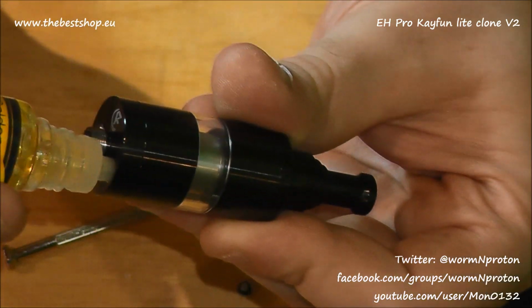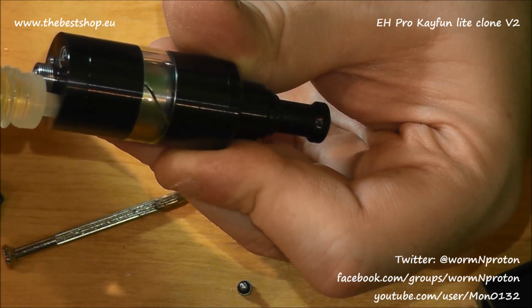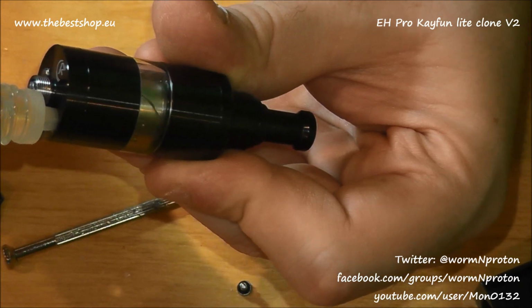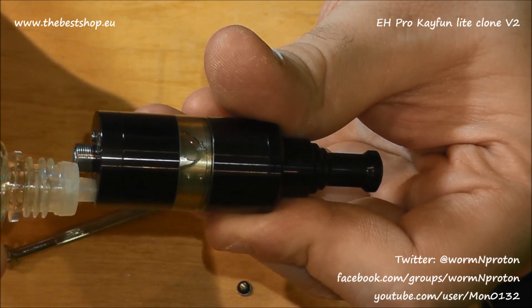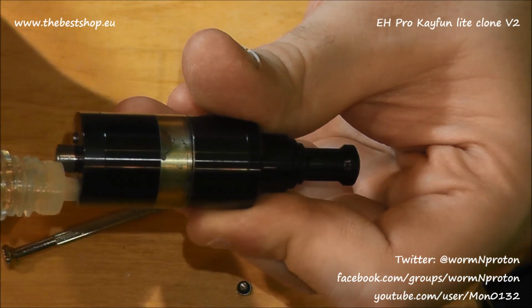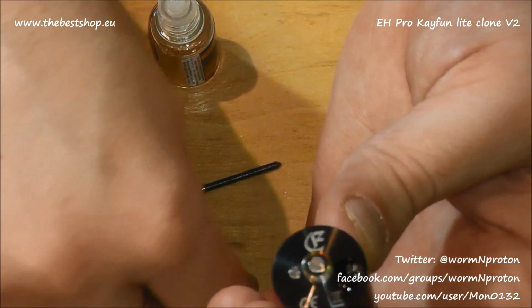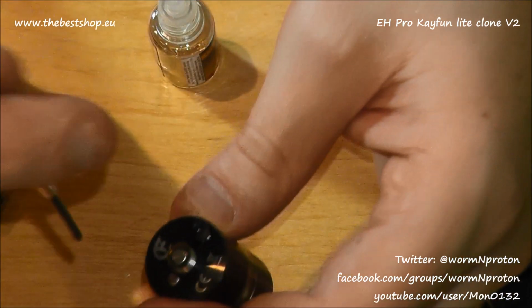Now 45 degrees is what we're after, and you can see liquid going into my little tank here. Keep giving it a squeeze, and basically what I like to do is, as I get to that angle, a little bit more of a squeeze, and see that air bubble's about to disappear? That's stopping time. So 4.5 mil in this tank at the minute, lovely stuff.